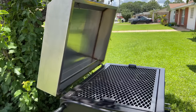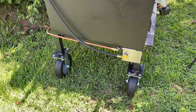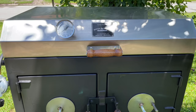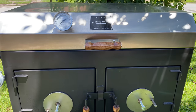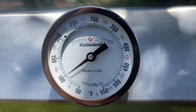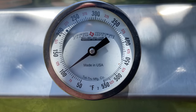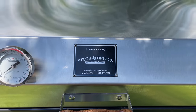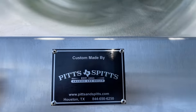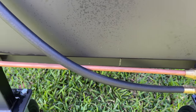It's good heavy construction. The actual body of the grill is 12 gauge — that is somewhere between 1/8 of an inch and 3/32nds of an inch thick, right in the middle at about 7/64ths. On the lid, if you notice, it also has a built-in thermometer. This is a Tel-Tru thermometer, which is the standard for barbecue grills. It's a customized Pits and Spits thermometer.